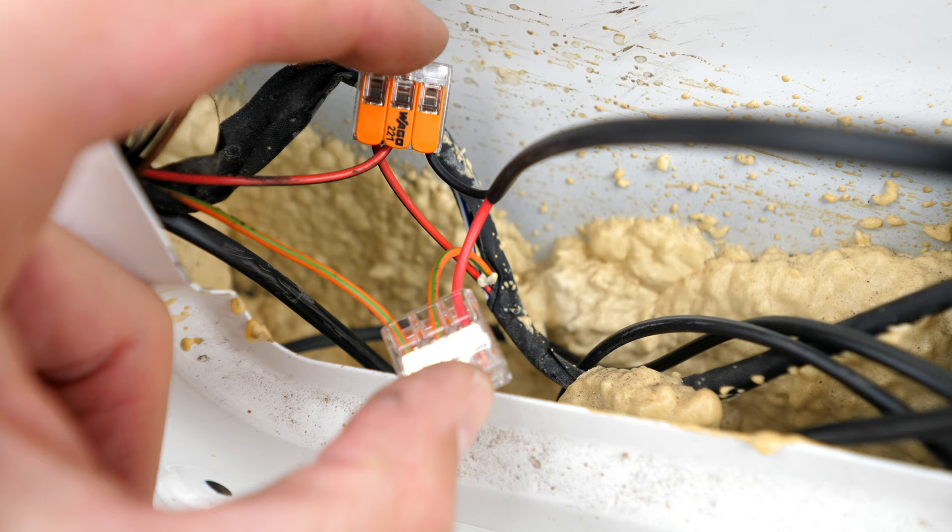...you have to connect the green cable of the Thunderbolt box to the orange cable with the green stripe, and then the blue cable of the Thunderbolt to the red cable with the black stripe. I didn't use the blue piggyback clips that came in the kit — I used Wago clips — but I haven't broken the original van wires; I've just allowed the Thunderbolt to piggyback off the same electrical current.